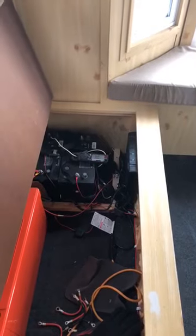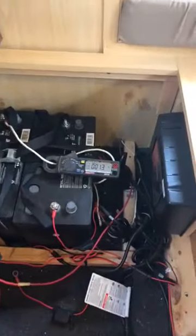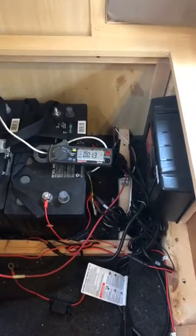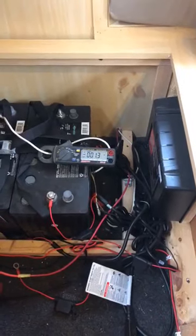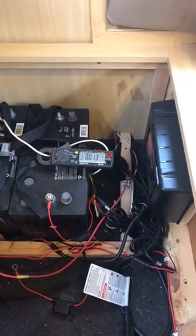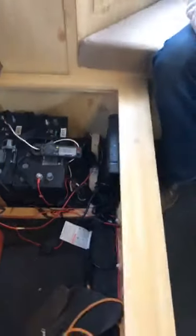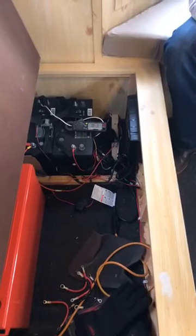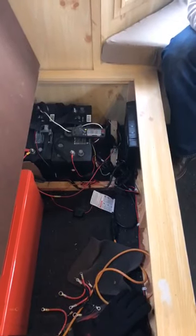What I'm going to do is flip on just the top lights. I have the standard top lights in here. I ended up changing out the bulbs from the standard incandescents to LEDs. So there are 6 LED bulbs in this house running right now. If you notice, it jumps from 0.1 up to 1.3. So my lights alone for the 6 bulbs, not including the bathroom yet, are pulling 1.2 amps, because the house itself was just pulling the 0.1.